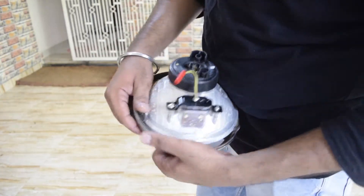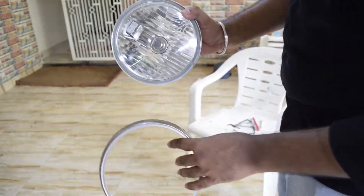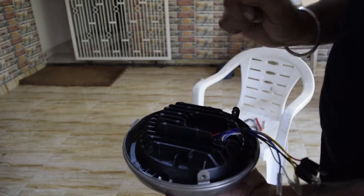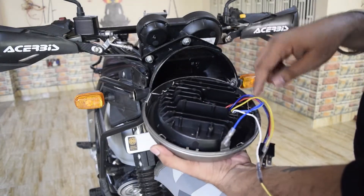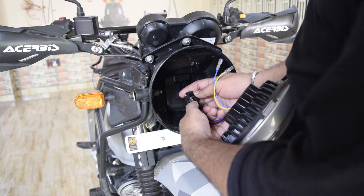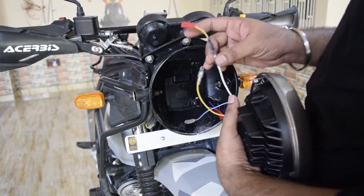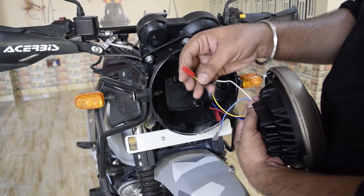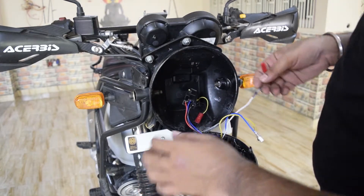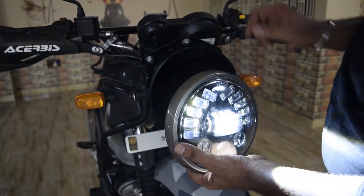We give pressure on the side and the light comes out. After putting the headlight into the cowl, we fit the pin from the previous headlight. I've fitted the cowl and the four pins. The socket connection is very easy — the main headlight socket plugs in directly. The white wire is for the DRL; I've cut the black wire from the old headlight socket since it has no use.